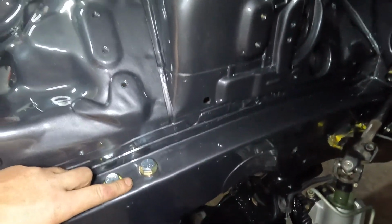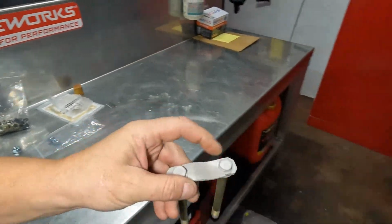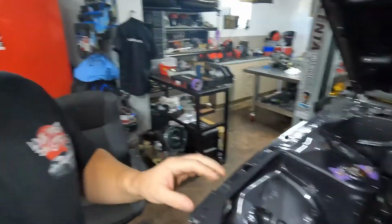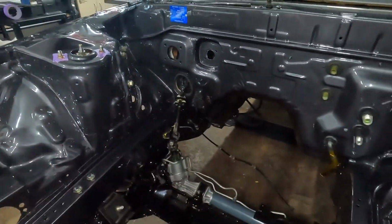The only thing you've got to be careful of is, because they're not joined now like this bolt, because there's no join in the middle, when you do them up, you have to be very careful that they don't turn. Little tip, 1/2 inch bolts work absolutely perfect on the subframe bolts. There's new nuts on the back too, which is good.